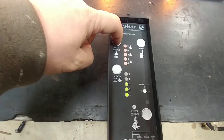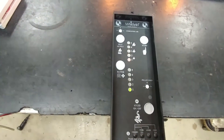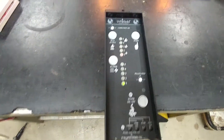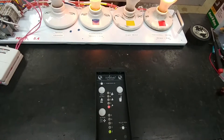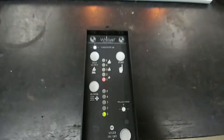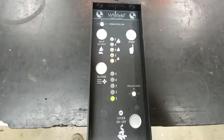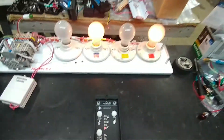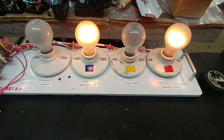I'm able to step back through those to one. If I press the auger button, the red light here will come on and the auger light will come on. Let's see if we can catch both at the same time — there it is. I have the auger light cycling on and off, the LED indicator coming on, and the auger motor simulator flashing on and off at the same time.